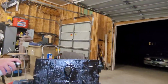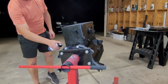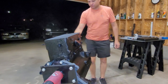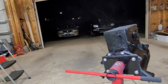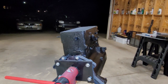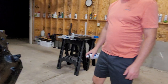As we get this thing out in the daylight, little spots are going to stick out that we missed that you just can't see in the garage. We'll get those coated with either just some nail polish or something just to keep them from rusting. There won't be enough of that to detract from the look of this engine. That's how you do it — you buy good paint. You don't use the parts store stuff. You buy this Eastwood 2K stuff and you get a good catalyzed hard paint on here so that when you're putting this thing together, that paint's not flaking off when this thing comes up to operating temperature.